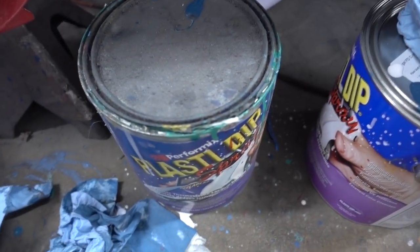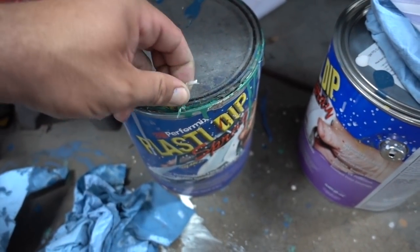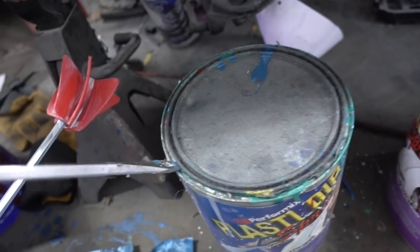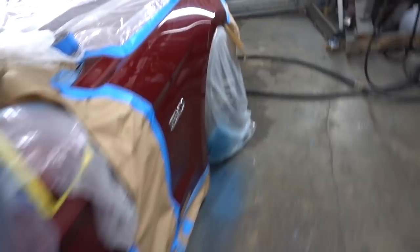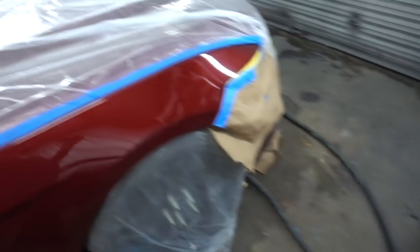So we're going to go ahead and go to our teal, which is going to be the fenders and the trunk. I didn't film a lot of how that color was made, just because batteries were low. But the original formula was electric lime with a bunch of blue thrown in. This time I had some teen green, I don't know how you pronounce it. I threw that in some clear, and then we mixed some blue and some yellow, because blue and yellow makes green. Gonna do a couple coats of white base just to bury the red. Probably be 2 coats of that, maybe 3, and then the green on top. So yep, let's go.